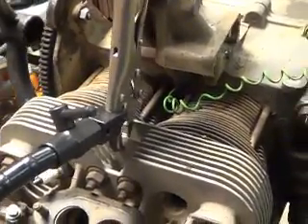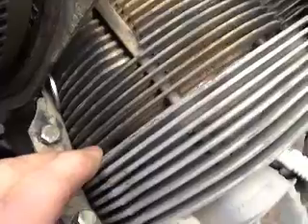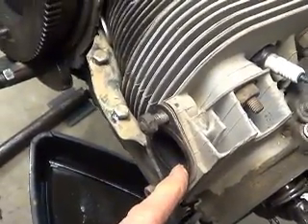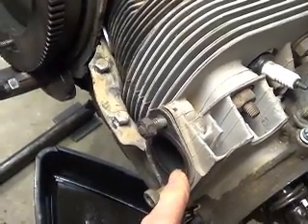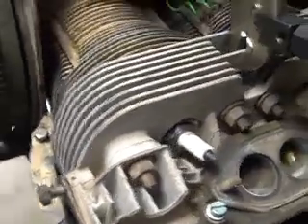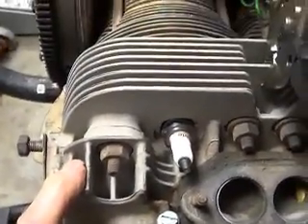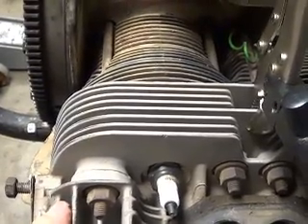Other things you look for are oil leaks. If this doesn't have the typical signs of oil, it could be something else, like a bad valve. I could have an exhaust valve that's going away — that would be a common thing on number three cylinder. The exhaust port looks a little wet here, but the intakes look clean and dry. You could also have a piston problem — a broken ring or something like that.